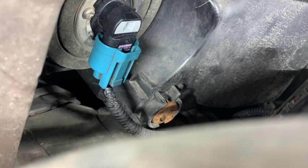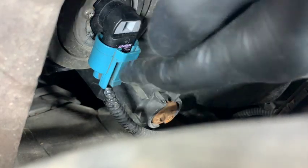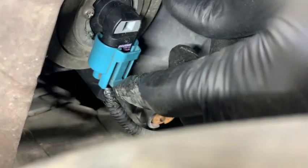We're going to look in behind the headlight, and right here is the bulb and this is the plug. We're going to pop both these out by turning counterclockwise.